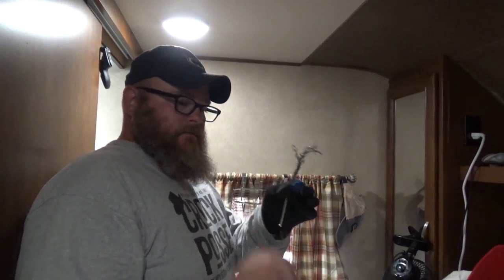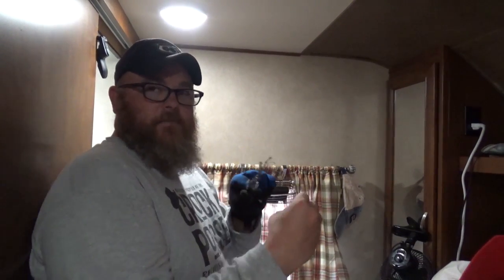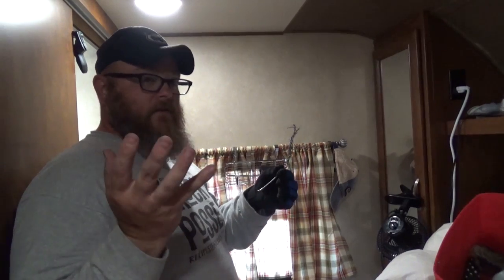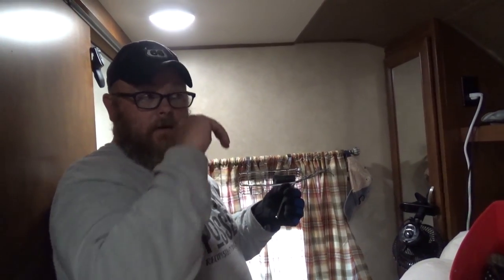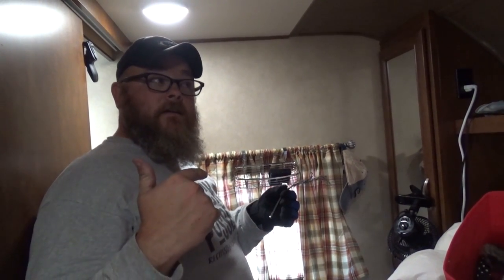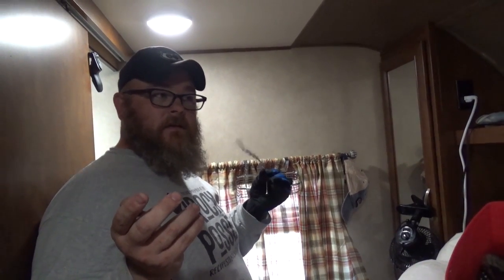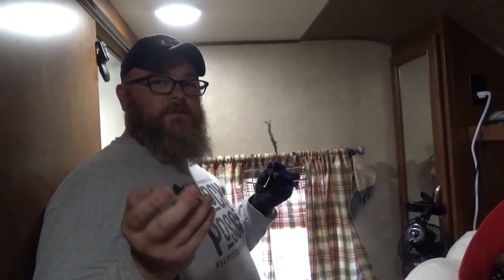Yeah. So when the cable got caught in the pulley and ran back and forth, it frayed it really, really bad and got caught into the gear. Here's the pulley. The cable's supposed to be in the middle, running on it, and it got caught on the side, and it just kept rubbing back and forth and tearing the snot out of it. So the only thing I could do to get it out of there was to cut the cable. So we have a cable on order from an RV supply store that's about an hour away from here, and it'll come there, in Price, Utah on Monday. We're taping this on a Saturday, so I need to come up with a temporary solution to our problem.